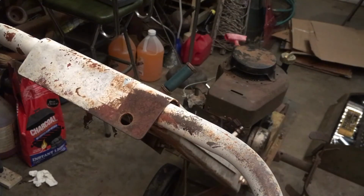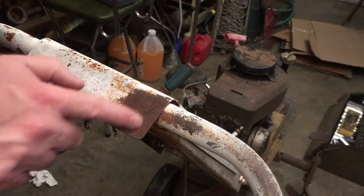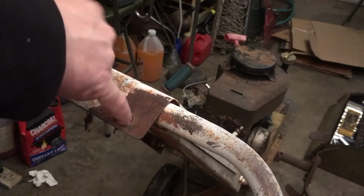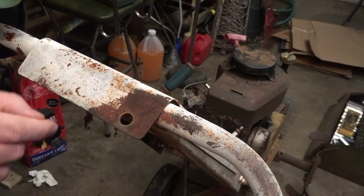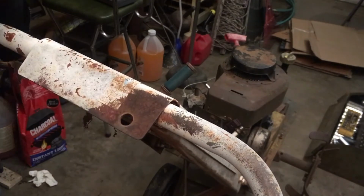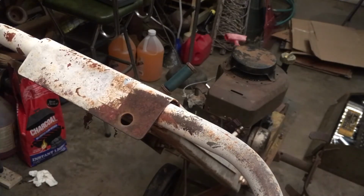Taking a second look at things real quick. This right here very well could be the culprit. That real fresh ring of rust right there. Electricity is lazy. It does not want to work harder than it needs to. So if there is just a bunch of rust in the way of the unit grounding out, then it's not going to work properly. So yeah, I'll bring you back.